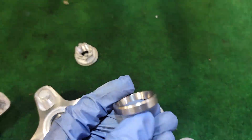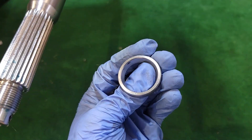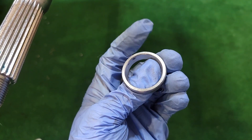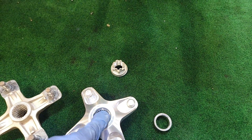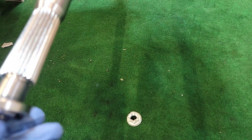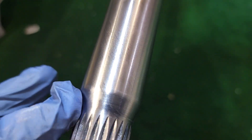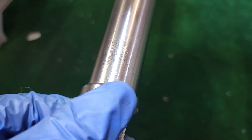In addition, on the inner end, you need this one here — on the inner surface, this one is conical, as opposed to the other one which is conical on the outer surface. The inner conical surface mates up with the conical surface of the axle there really well.